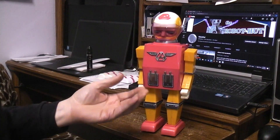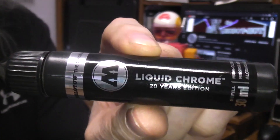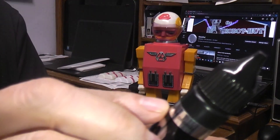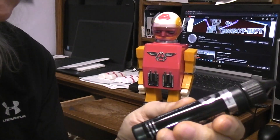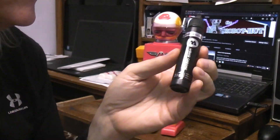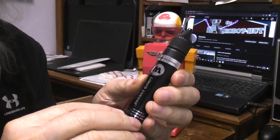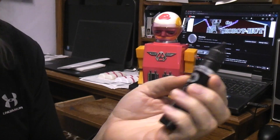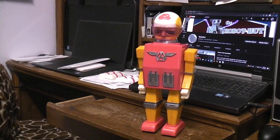When the chrome gets scuffed off, what's underneath is black plastic, so you see a dark area. What I like to use is Molotow liquid chrome — this is the refill container. It's a lot cheaper to buy the 30-milliliter refill than their little pens that remind you of a felt tip pen. You get 30 milliliters of product rather than one or two. Just apply it with a small paintbrush — a wet coat — and it'll flow out and give a very nice finish.